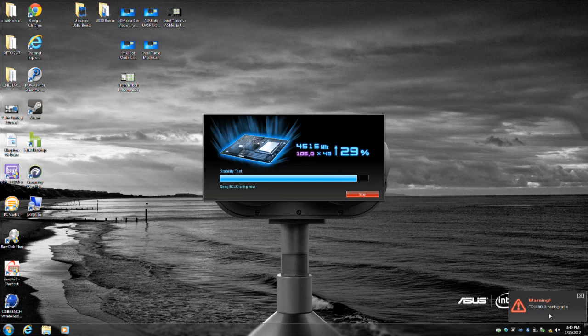Some users will wonder: how close does this automated system get to actual maximums? If we say 4.8 GHz is our realistic manually tuned maximum — based on hundreds of CPUs and multiple steppings tested — you're usually getting somewhere between 4.5 to a little over 4.5, with the best auto-tuned CPUs reaching almost 4.6 GHz. That's not that far from the upper-end frequency of 4.8, and keep in mind that if you do want to manually tune after, you can always go further — the auto tune lays the groundwork. That value is stored directly in your UEFI, so you can uninstall AI Suite if you want and the setting remains.